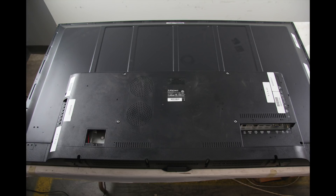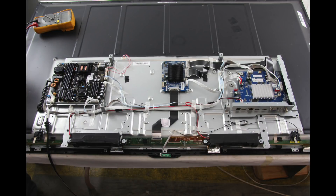If you cannot see any light coming through the back cover, I would recommend removing the back cover. There should be holes in the back panel which is underneath the back cover. Once you have powered on the TV, turn all of the lights off in the room to give you the best chance to see light coming through those holes. If you do not see any light, then it would appear that your TV backlights are not working.